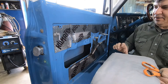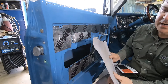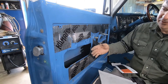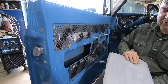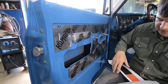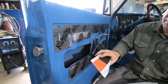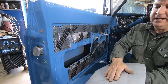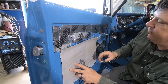So you might think I'm crazy here, but I made my own little water shield — it's just made out of a synthetic roofing material, which could have been tar paper, which is sort of what these trucks had originally. I used two pieces of it and left the slick side to face inside so any moisture or water that goes in the door runs off. Then I used a UPS envelope that's got the little bubble-style protective layer and sandwiched that in between the two pieces to make kind of a pad — so we've got more there than the factory ever dreamed of.